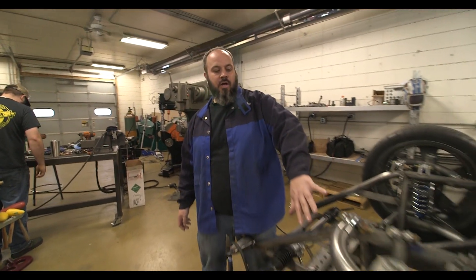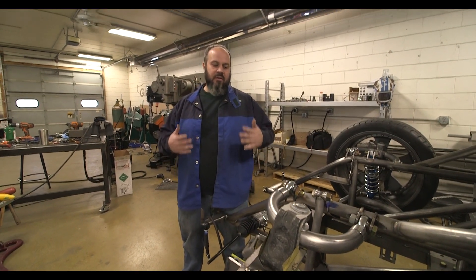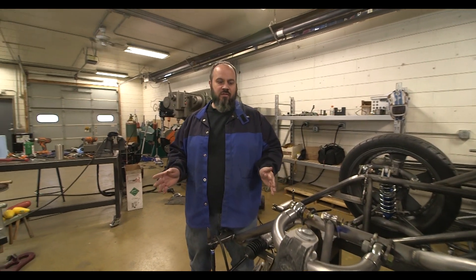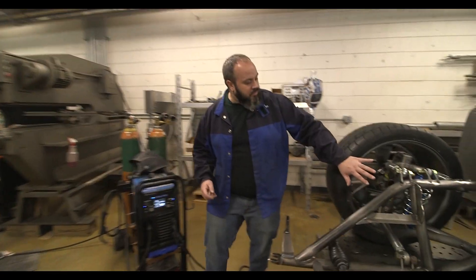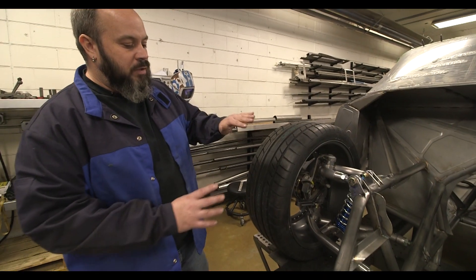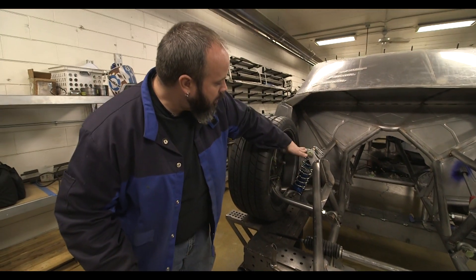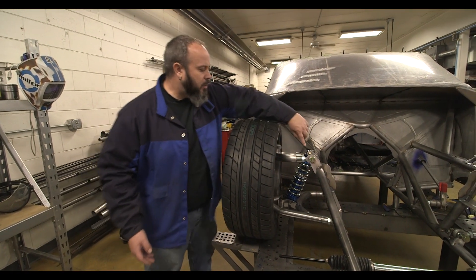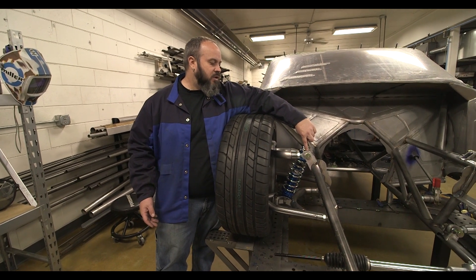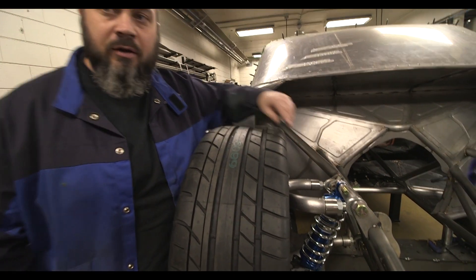This side is still in the process of being fabricated, but Brian gave you an idea of what it takes — every part is literally handmade. We hand machine it; a little bit of CNC comes in, but for the most part everything is handmade. A lot of times when you hand make stuff you screw stuff up, throw it away, start over. This other side is pretty well complete — we've got a lower control arm, upper control arm, shocks all mounted, all our bracket trees made, and all our little tabs. We actually machined the washers, welded the washers to the tabs, and then remachined them — it's a huge process, and we did that for every single tab.